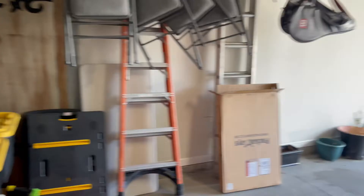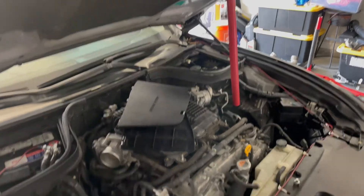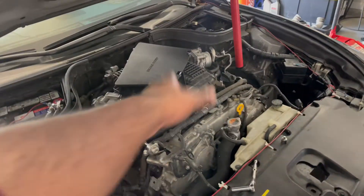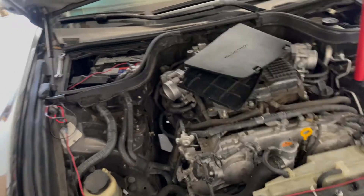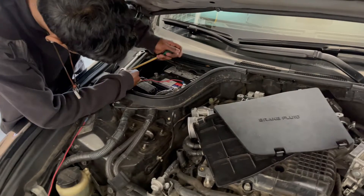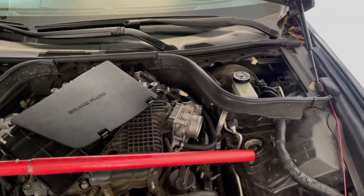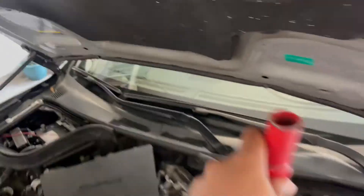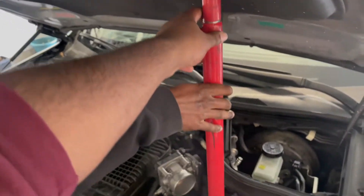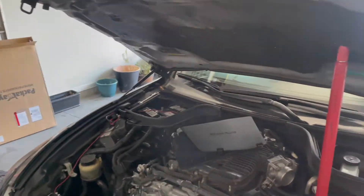So we're gonna try to record as much as possible and as best as possible. Right now Myon is just taking off all of the unnecessary stuff like the intakes to make more space. Make sure you always unplug the battery first — that should be a given, but you don't want any weird shit to go wrong. Now he's taking off the hood so we'll have clear space.